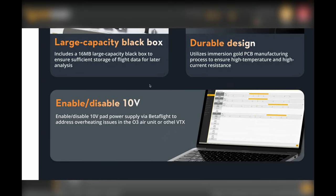Time for the weigh-ins. The mini is 12.76 grams - that's pretty light, almost AIO territory, but so much easier to work with than an AIO. It's rated for 40 amps per motor. One of my freestyle/racing drones pulls 80 amps total across all four motors at full throttle - this can handle 160 amps total, which is more than enough. As for power surges, that's where the bigger stack comes in for added confidence.